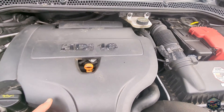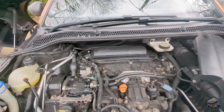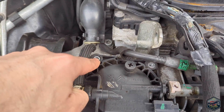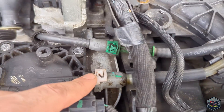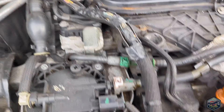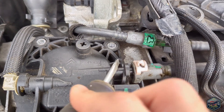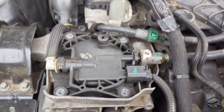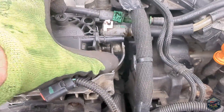In the RCZ HDi it's really easy. First, remove your engine cover. Once you've done that you've now got your fuel filter here. You remove four screws — one, two, three and four — and then you're going to remove this high-pressure fuel hose here. Really simple: you just pop this middle bit up here and then put a screwdriver and wedge it out. Now we're going to lift out the fuel filter and pop that off like that.